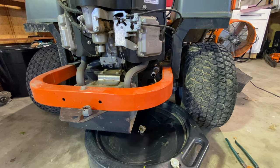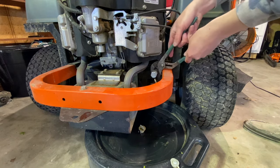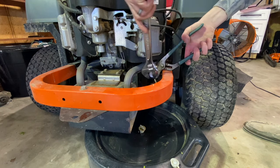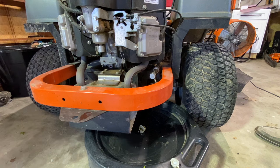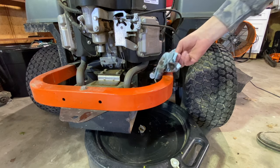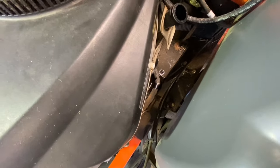Before we refill the oil, we're going to put the oil plug cap back on. That guy just spins right back on, and I'm going to clamp down with my channel locks to get a good bite on it and tighten this up so we know it's not leaking. That ought to be tight enough. Now before I even start pouring oil in, I like to do a quick cleanup. Take shop rags and wipe things down - the idea is that if you wipe things down you'll notice oil leaks in the future.